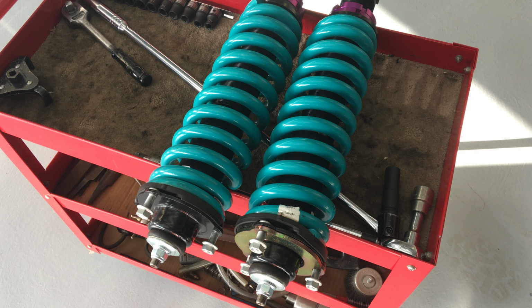So just picture it, your wheel is what moves the most. That's the furthest point out. It's going to go up and down, let's say 150, 200 mil. Let's say 200 mil, just for a number. It goes up 100, down 100. And then you've got the middle point. But as you go in the arm to the pivot point, it basically doesn't move. Right on the pivot point doesn't move. And the further you go up the arm, the more it moves.